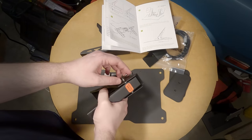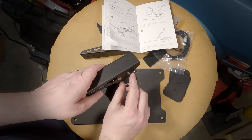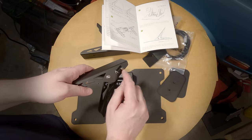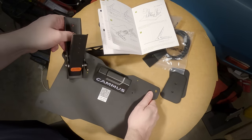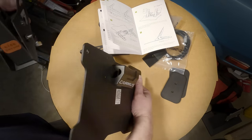Oh, this thing is the arm that actually activates the little... This is probably a magnet. Yeah, this is a magnet. And this magnet is what gets detected by the little sensor in here. Okay, I'm getting you now. Now, to put this thing together, you kind of have to tilt the pedal a little bit and slide it into that slot there.